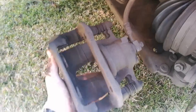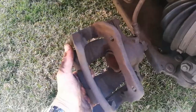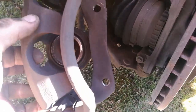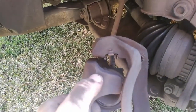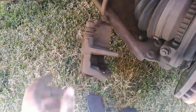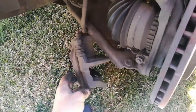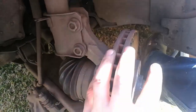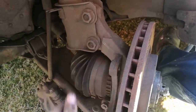Now the piston is already back. I can just insert the two brand new brake pads. Please don't lose these spacers — if you lose them, you're gonna have a cluck-a-cluck-a-cluck sound the whole time when you're driving. All we do now is put the two new pads in, slide it back over the disc, put back the two bolts and Bob's your uncle.